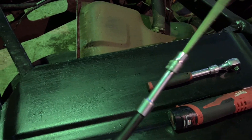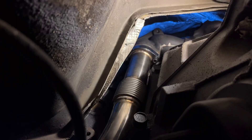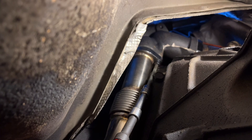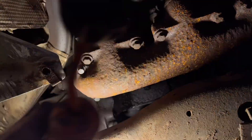I had this running it up and then this tightening it up. There's that one bolt — that's the one you might have to remove the cross member for — and there's the other one. It's not too horribly bad. Now it's time to do the bottom bolts on both sides: the driver's side is a 10mm and the passenger side is a half inch. Got the extension, swivel, and 10 millimeter deep well to reach them.